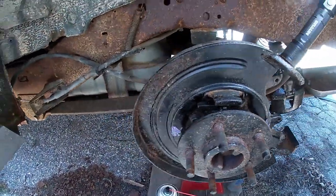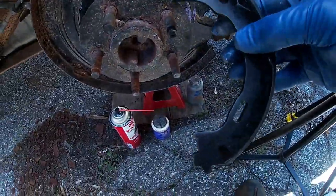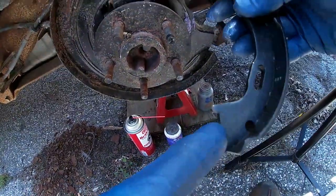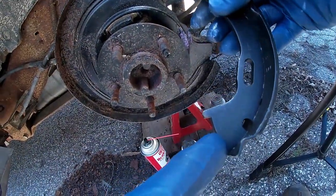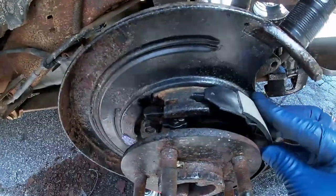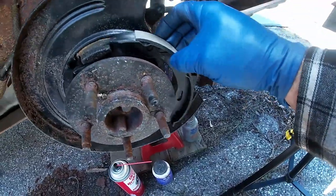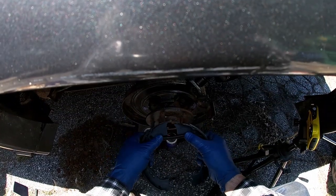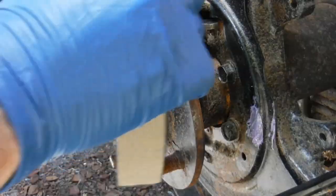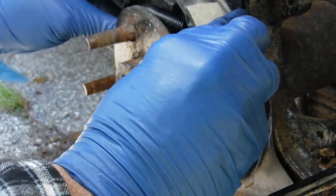Now, again, these brake pads have two distinct halves. The one with the little square bracket indent and the one without, with this little point. Little point goes on top, slides nice and smooth into there, and the other side the same way. So what we're gonna do is first put the big spring on it and get that into position, like so.